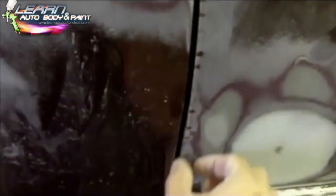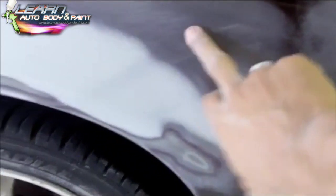These little dings and dents are all good. We still have to work on the edge of this fender because when we rolled it we pinched it shut with pliers, so we have little ripples in here. We're going to put a little skin coat of Bondo in this area. We also missed one ding right here, so we're going to fill that too.